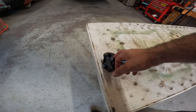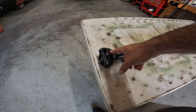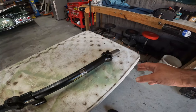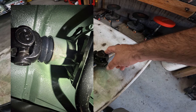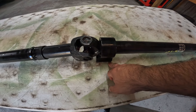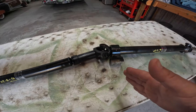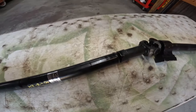Not only that, but the u-joint was wrong, so I had to take it back to have them swap out the rear u-joint. When I installed it, it was rubbing the dust boot on the tail shaft of the transmission — which is a no-go. I also had to elongate the frame holes where the carrier bearing bolts because it was too long, so pushing the whole thing back shortened up the play on the slip yoke.